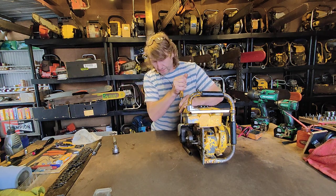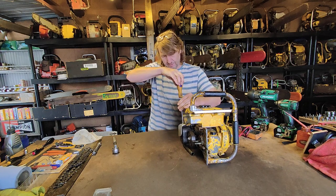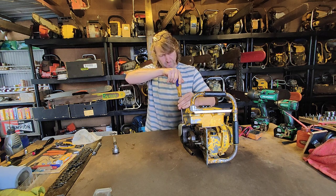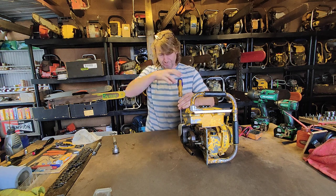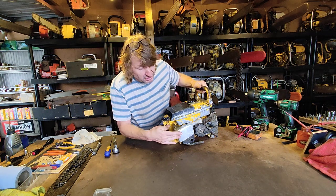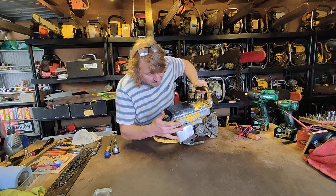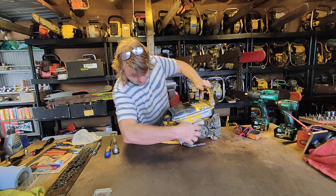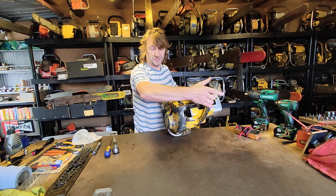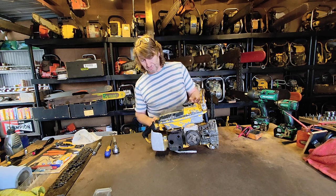Okay, take off this side here, maybe. It's really elegant, I really like the access here as well. So on this particular McCulloch, you take off one screw on the right hand side, which bolts into the top of the muffler, you pull it across, and then it hinges back and gives you access to the spark plug on this side. So when we get a bit closer in, we'll zoom in and it'll be really interesting what we find.